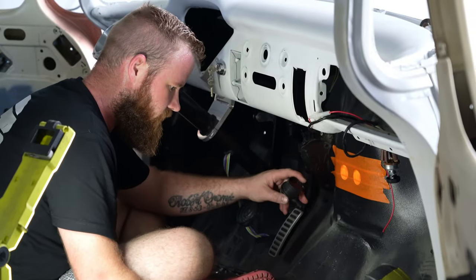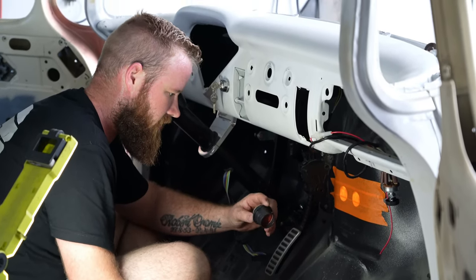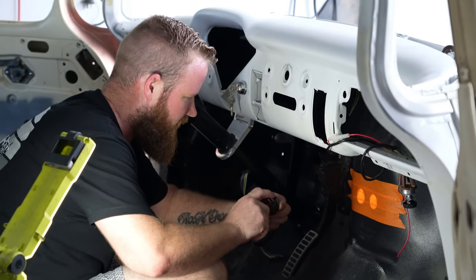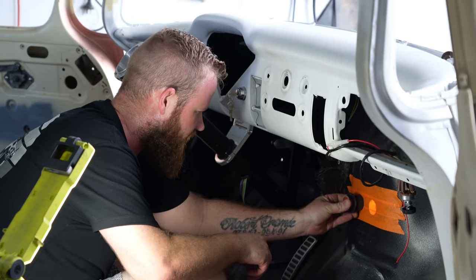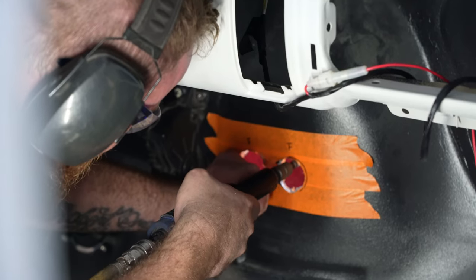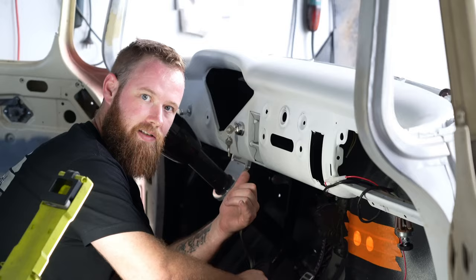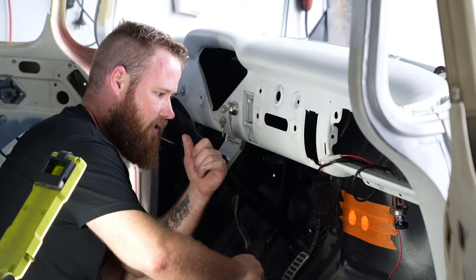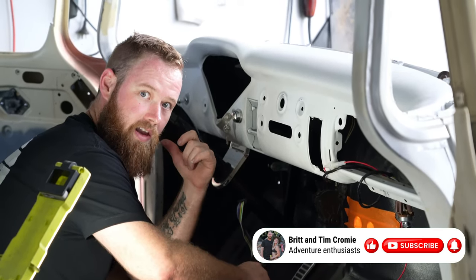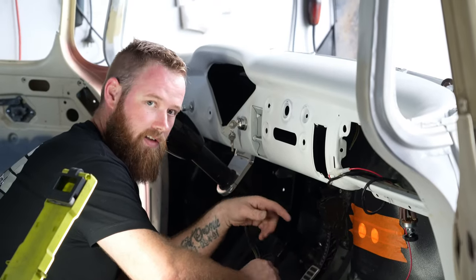I've just cut the holes in the firewall to 36mm, but they need to be 43mm. There's a little flat spot on the top of the bulkhead, so the flat spot stops it from rotating. What I want to do is basically transfer that onto the firewall and then die grind out enough to slide it in, but keep the flat spot on there. My die grinder's busted — my 240-volt one, the one I always use — snapped the plugs off the end of it. So I've found an old air die grinder. Hopefully it works well enough to get this done.